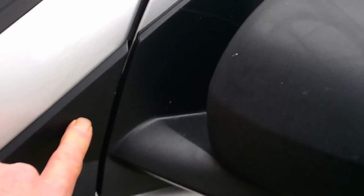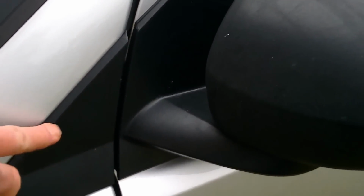That's the entry point, and you can check this, before you do that puncture in the foam, by just pouring water over this bit. No need to pour it all over the whole car like I did and like everybody else seems to be doing. That is the entry point into the A-frame in there. Now that just pulls off.